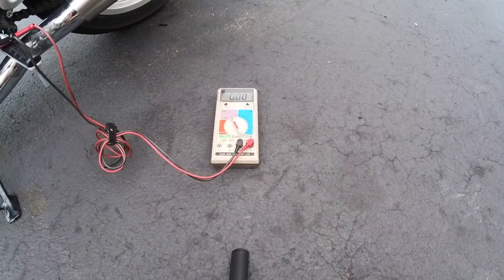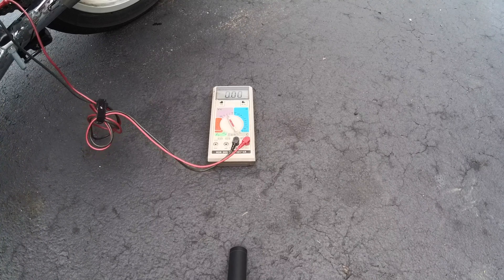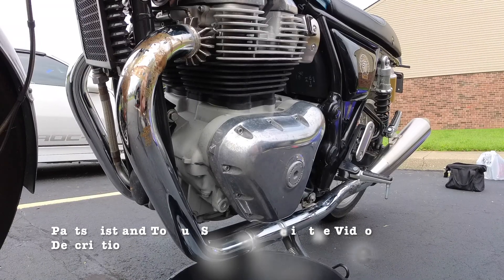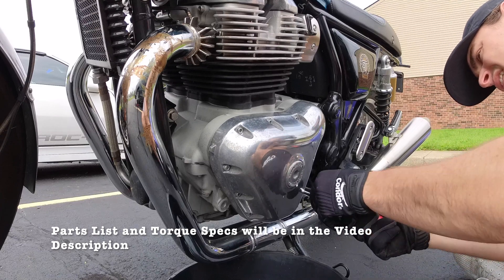Since I was alone and the bike has a kill switch in the kickstand, I figured I could try and get a reading directly from the alternator while it's running. The bike would not run with the alternator disconnected, however, so I tried getting a reading with just the rotation from the starter. At this time, I didn't know there was a rectifier regulator that wasn't part of the alternator assembly, so I figured it had to be the alternator that was broken.